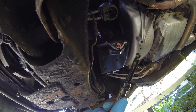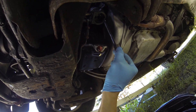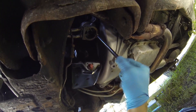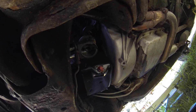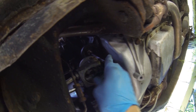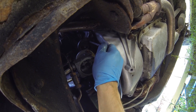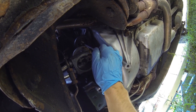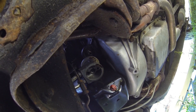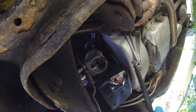Hopefully it does and I can just use this adapter. I only put it back on because I didn't want to have to hold the thing while breaking it free. The bolts were barely even snug. I've got the adapter off again and check that out - it threads right into the block. Next I'll clean the mating surface on the block because I did have RTV on there. I'm just gonna scrape it down to bare block and then the oil seal on the filter should catch and seal that up really well. I've successfully eliminated my oil cooler without buying anything - I'm literally just taking it off.